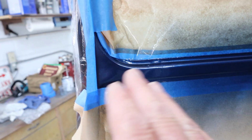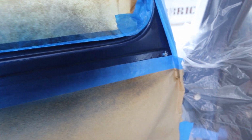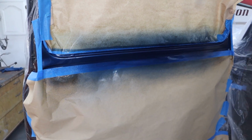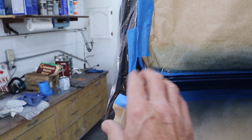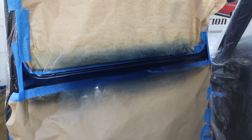So it's looking so good right here, right where the new clear blends into the old clear. I think I'm just going to go ahead and polish that, not color sand it. We'll try polishing it first without color sanding, and then see how it comes out. But that's going to have to wait till tomorrow. I'm going to leave everything masked because I don't want compound flying all over the truck. I will pull this back because we have to polish all the way up around there. But other than that, we're going to leave everything masked off. So see you in the morning.